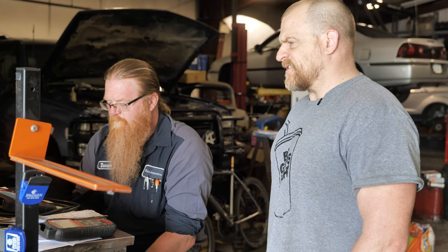We've seen this before, especially with the one you were explaining the other day, where it's taking that voltage and pulling it up higher to get rid of any kind of hash, and maybe it just wasn't designed to work in that range. Yeah, possibly. When they use the ground bias to pull it up off of noise, I've definitely seen problems in Chryslers with that design. But that was more related to the O2 heater and how that was done. I'll put a link here for the pulse width modulated heater circuits Chrysler switched to that caused problems. I go over this in classes too, in chapters 4 and 5. If you have more questions on that, go there.